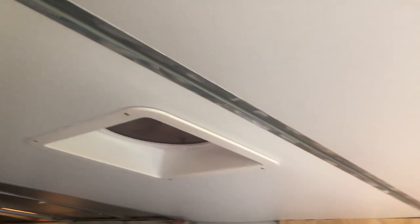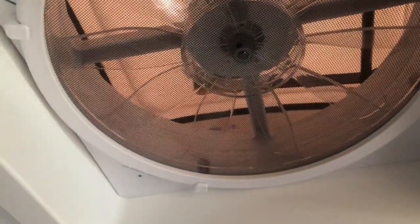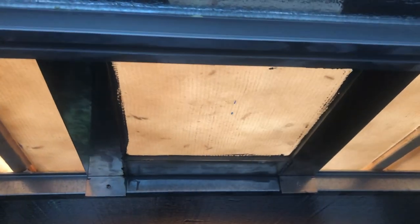In my opinion, super clean look — fully insulated. We have our 12-volt fan with pop-up vent installed, with one located right here. We're going to locate the second one right here. We're using Siliprene — this sticks to anything — to seal the roof because we're going to cut this area out to mount the other fan. We made an aluminum support bracket, and these aluminum support brackets are mounted in as well to help reinforce the roof.